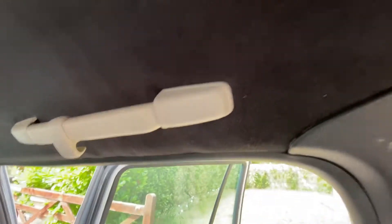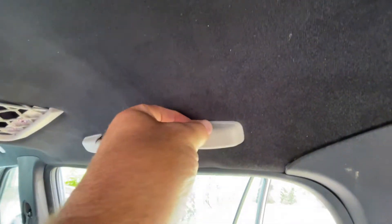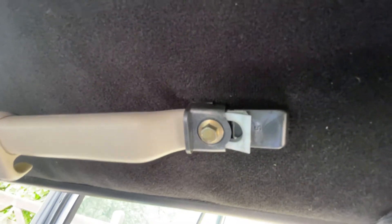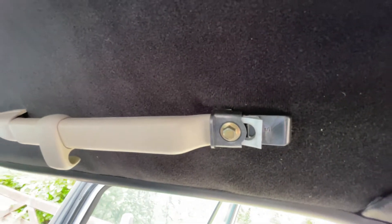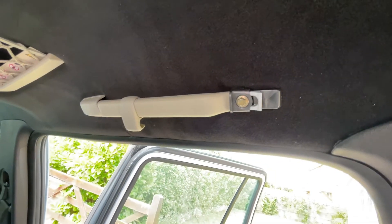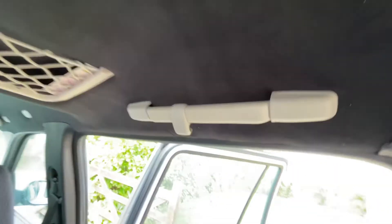For the door handles, when you take off the end covers don't just pull — you'll break the little lugs off. Pull out the top, then the bottom, and that gives you access. I used a 7mm socket to get them out. When putting it back together these plates might turn, so make sure the shoulder is on the inside because that allows the clips to go back on nicely.